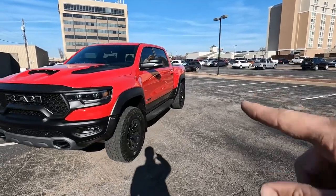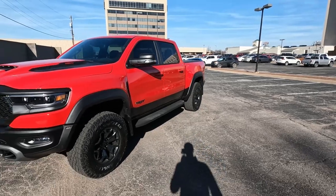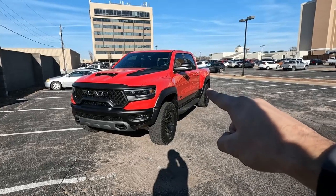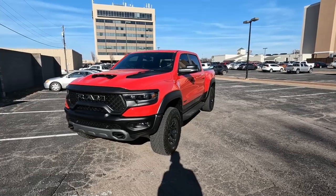Now, like we talked about, that's because of the fuel tank that lives on the driver's side, and it's 33 gallons of heavy fuel. So the repair is replacing the left front spring and the left rear spring with one part number heavier on both of those. So let's get into the shop, tear this thing apart, and see how bad springs are to put on a TRX. I'm gonna throw you guys up on the time lapse and we'll see what we can do.